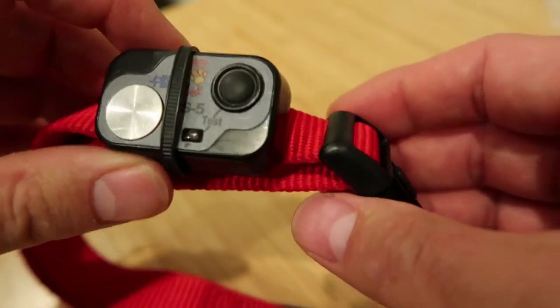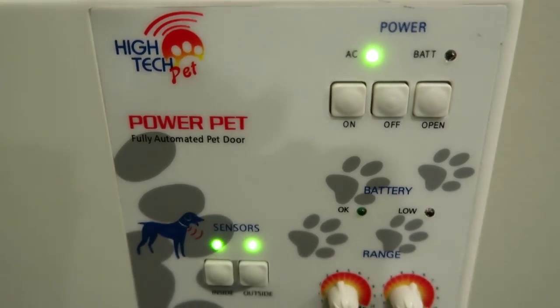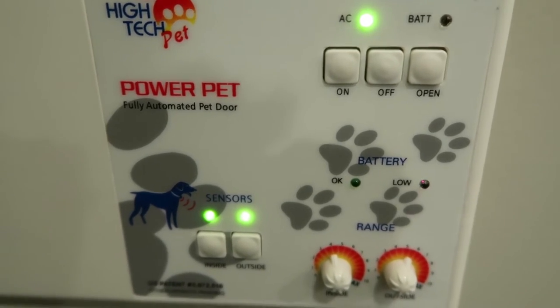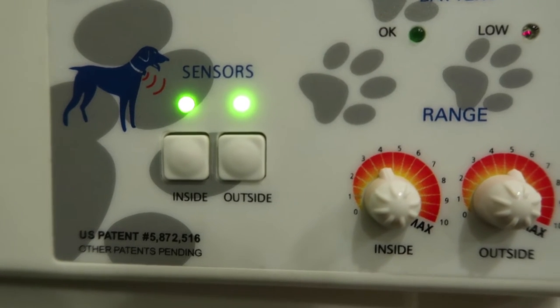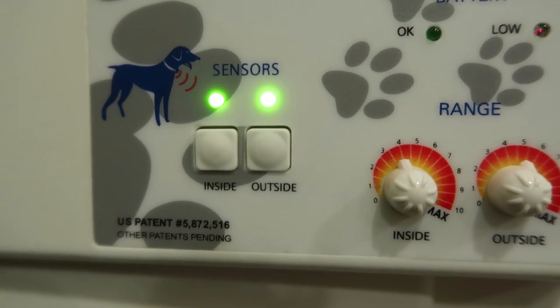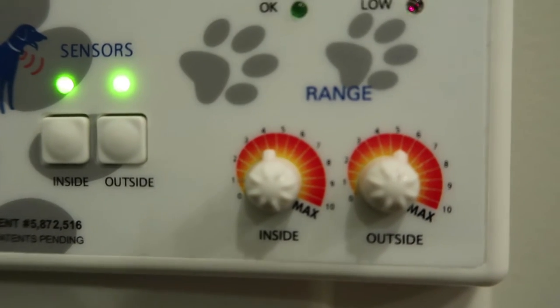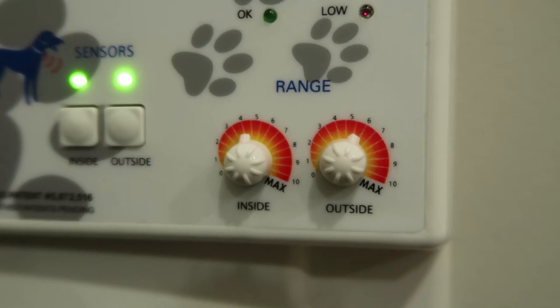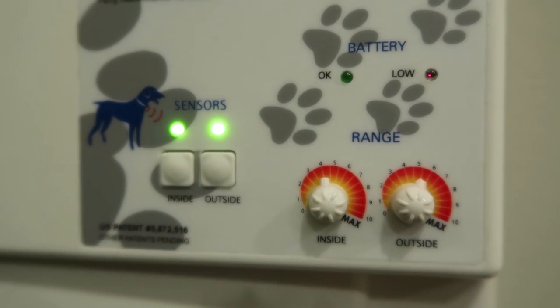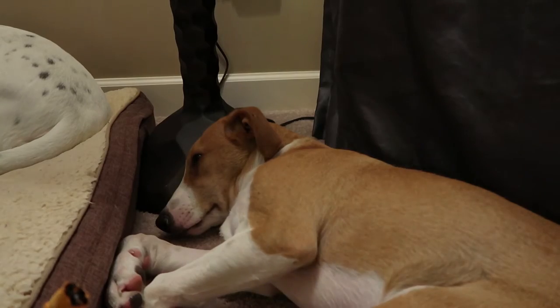It's been working great. This is the dog door — High-Tech Pet, Power Pet is the model — a fully automated pet door. You can turn it on and off, open it manually if needed, and it closes on a timer. You can set how long that timer is. You can also turn the inside or outside sensor off — say you want your dog to stay outside once they go out. The knobs on the right control how powerful the sensor is, and I specifically noticed that as the battery gets older you have to turn those up.